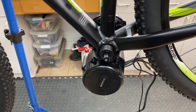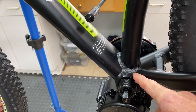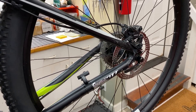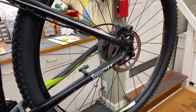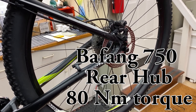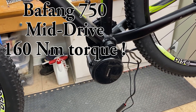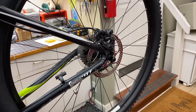That's why we chose this mid-drive. You've got to have a strong frame for the mid-drive too. Let me tell you something quick about the mid-drive motor versus the 750 watt Bafang rear hub motor. If you're wanting torque and wanting to climb with this bike, the Bafang 750 watt rear is 80 newton meters of torque. On that Bafang I showed you on the Rad Rover, that rear motor is 80 newton meters. On this mid-drive, it is 160 newton meters — huge difference. So you're going to get a lot of climbing power out of the same size motor on a mid-drive as you would on a rear hub drive.